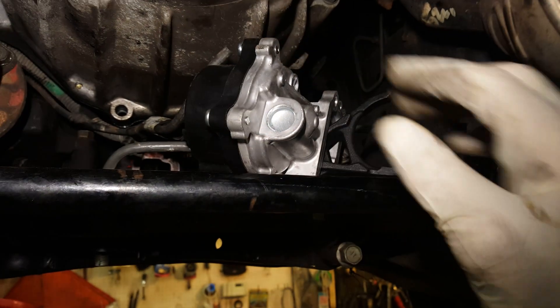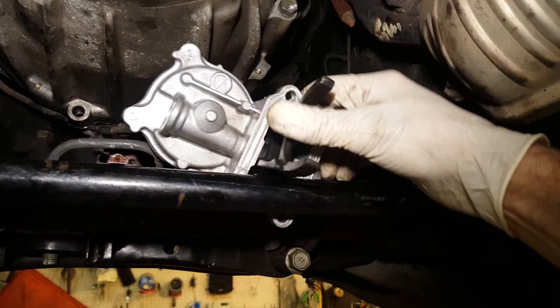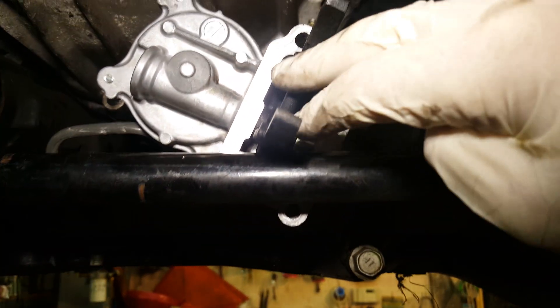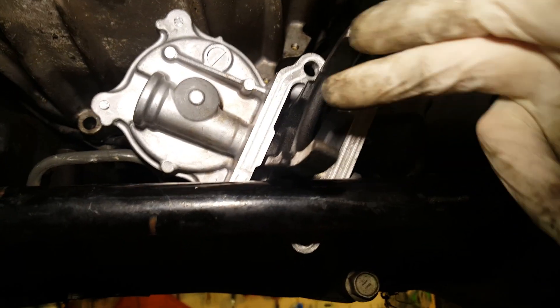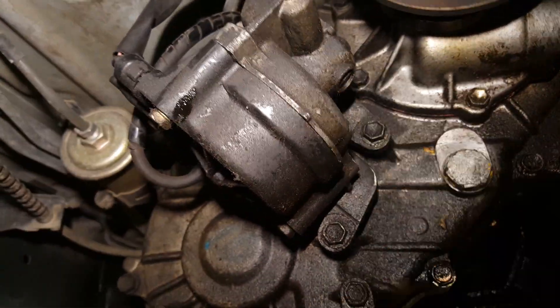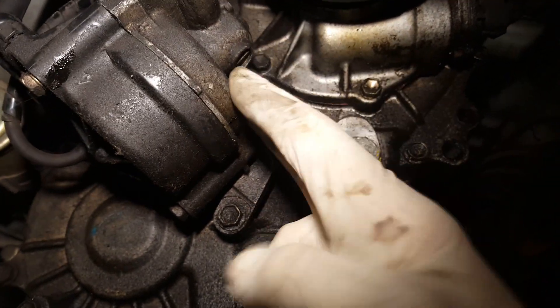So what I did: you can see the actuator fork — it's to the left side of the opening. I'm going to press the button and it's going to slide to the side. I found out that this actuator on the transfer case was stuck. I had to tap right here with a ratchet — something metal — and I got this unstuck to send a signal to that. So let's press the button.